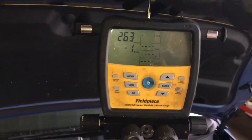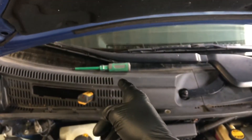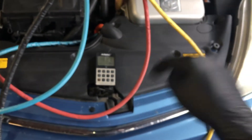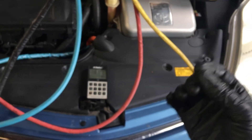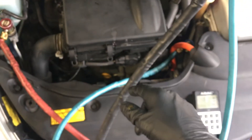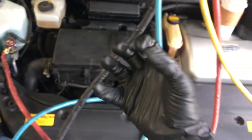There's just no realistic way of removing moisture using a vacuum pump. In this case, you have a brand new evaporator out of the box, sealed from the factory with dry nitrogen inside. You have a condenser brand new from the factory — they're sealed when manufactured with dry nitrogen pumped through them. You ever notice when you lift the caps off you get a little hissing sound? That's because they're structurally dry internally. Same with the compressor — on OEM Toyotas the compressor contains enough refrigerant oil for the whole entire system, so that oil has to stay structurally dry.